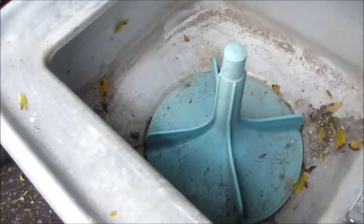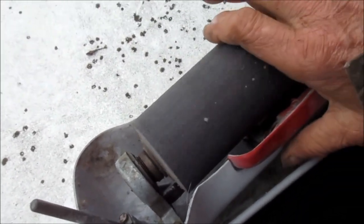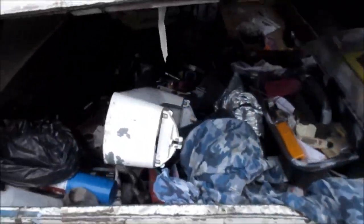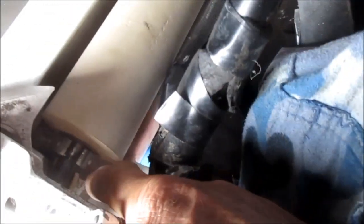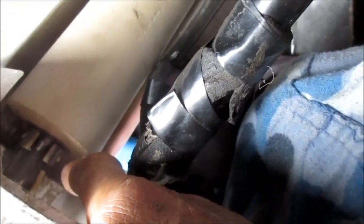It's an agitator. This is the headpiece here, and the headpiece has really good bearings still. This piece here sits on top of that. You can see what's happened is these little bushings in here are kind of worn out. I think that's the only thing wrong with this thing — these little bushings right here are worn out.